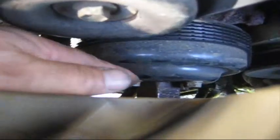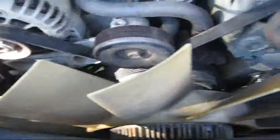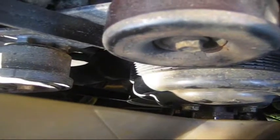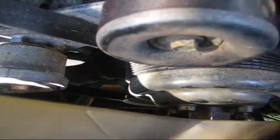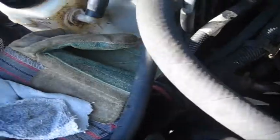in between the bolts that are holding this plate on. You could try just tapping it, getting a wrench that fits, and giving it a few quick wraps with a hammer. It will spin, but if you do it a few times, it should come off. And another precaution you want to take, my battery has side mounted terminals, but I did cover it up just in case a wrench should slip or something should go awry. Or you could just disconnect the battery to play safe.